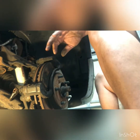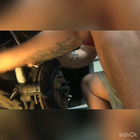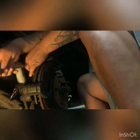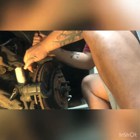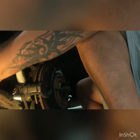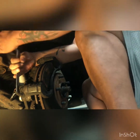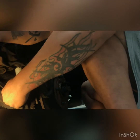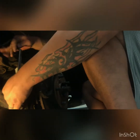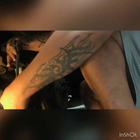So that came right off. Good job. That goes down there. Take my offset 18. That's gonna go right here. And then we're gonna go in an up position. Now, like I said, you don't want to use the ratchet wrench for this because you might get it stuck. And if that happens, that's a bad time. Oh man, these are on there. And I'll show you all the rest on these here in a second. This is really bad. This vehicle came from New York, so there's a crap ton of rust on this thing.